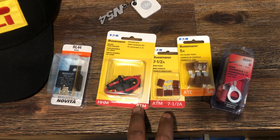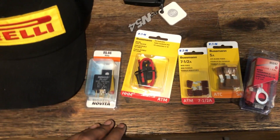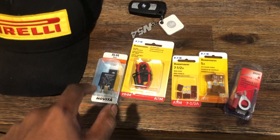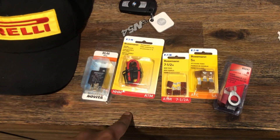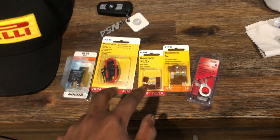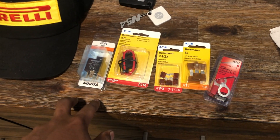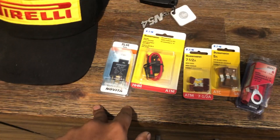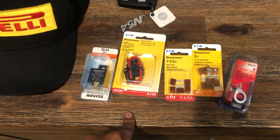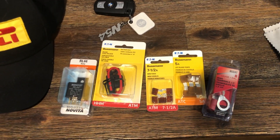It says ATM fuse here which is a small fuse, but it also said ATC at the back, so I bought one of each — 7.5 amp is ATM, 5 amp is ATC. Regardless, essentially what we have here is a relay. How a relay works is it draws power from the battery itself but uses the reverse lights as a switch to turn on that power from the main battery — a smaller circuit switching on a larger circuit. The reverse light setup is the 9-volt smaller circuit and the reverse camera will get the full 12 volts. This should also give a cleaner power source, meaning fewer wavy lines on the camera. I do have a noise reducer for electrical lines if needed, but hopefully we won't need it.